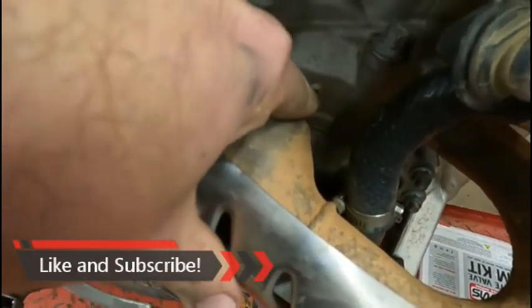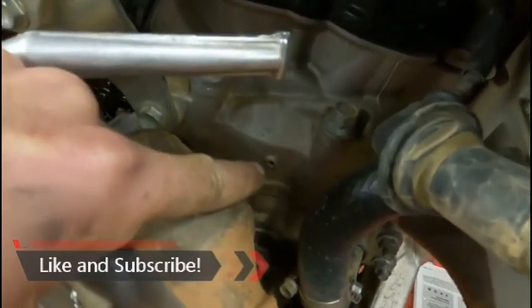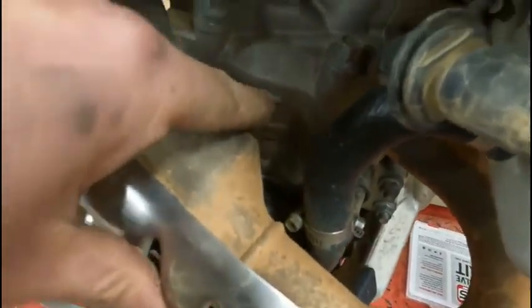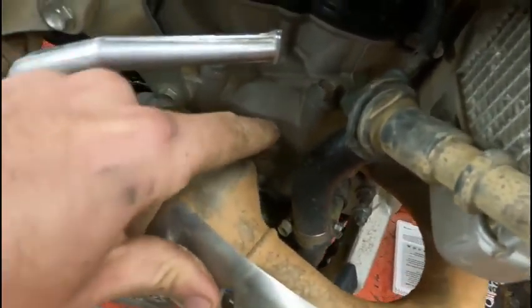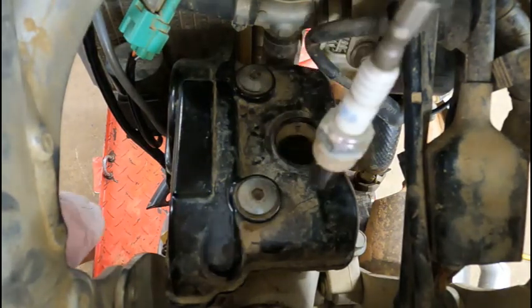I should be able to blow air back through that, and it should come up the top of the spark plug hole. So if you ever see any liquid or water or something coming out of that hole, all that is letting moisture out of the spark plug hole cavity and running down the cylinder. That's what it's designed for. So make sure you blow that out really good before we pull this top off, because we're gonna pull the spark plug out. All right, I used a 5/8 spark plug socket, and it fit down over top of that,